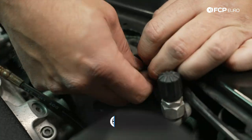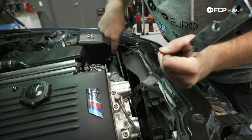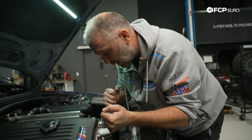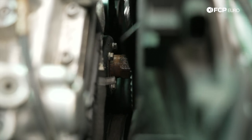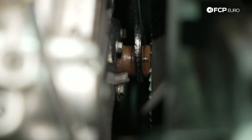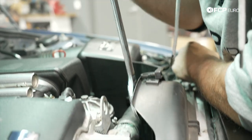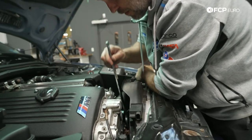On the upper side there's a T25 Torx screw to remove. Next, take the fan counter-hold and a thin 32mm wrench and crack the fan loose. The fan clutches are reverse-threaded, so spin it to the left — moving the wrench clockwise while looking at it, which is actually counterclockwise facing the nut. Sometimes these are very tight because they've been over-tightened or on there a very long time. The CTA counter-hold and wrench set has a half-inch drive for extra leverage.